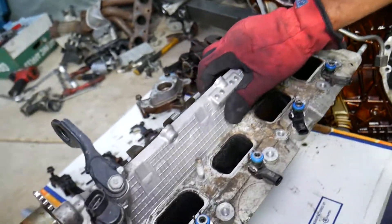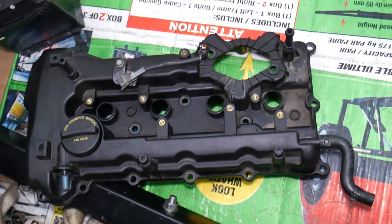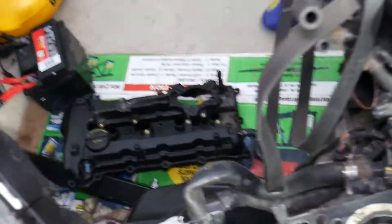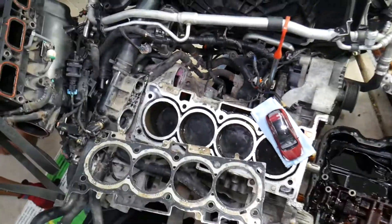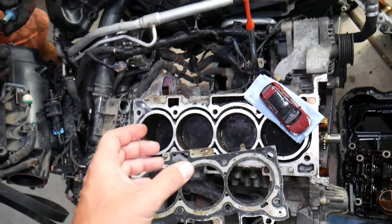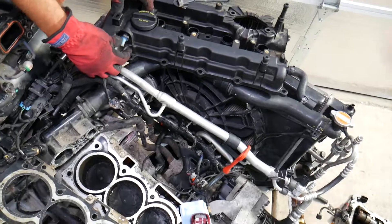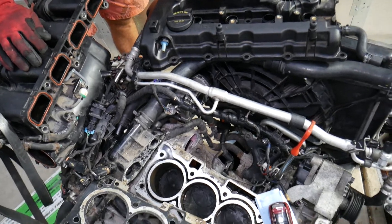So what causes that? On top of the cylinder head you have the valve cover, and on that valve cover there is a device known as a PCV valve — that stands for Positive Crankcase Ventilation. When the engine runs, pistons go up and down, creating internal pressure. You will also always have some blow-by gas around the pistons. That gas needs to exit the engine; otherwise you'll have multiple oil leaks, gaskets will go bad, oil seals will fail, and your engine will essentially be destroyed.